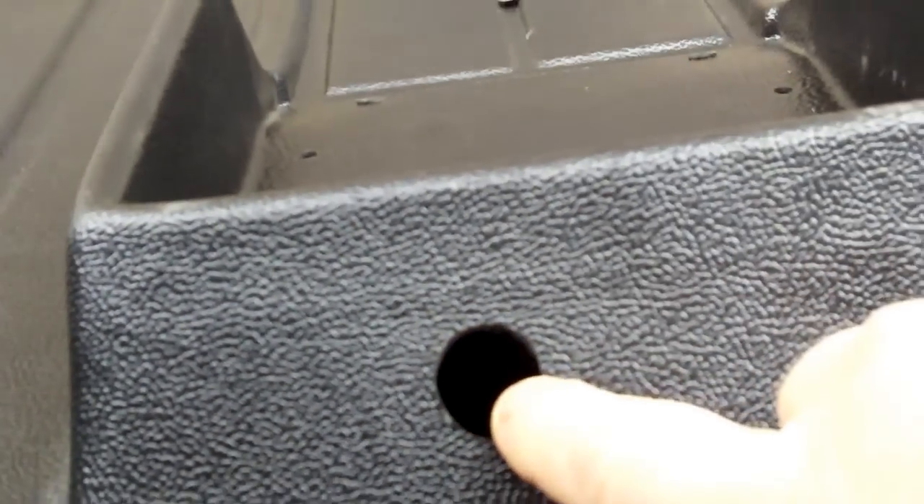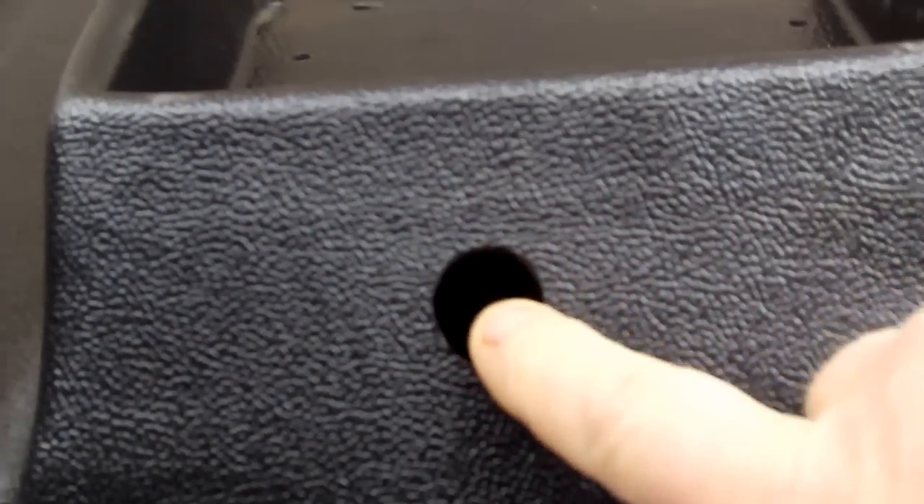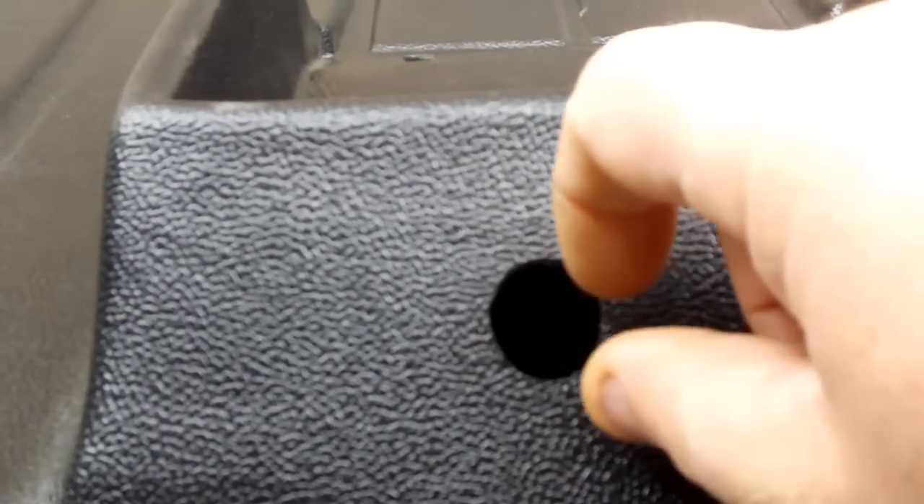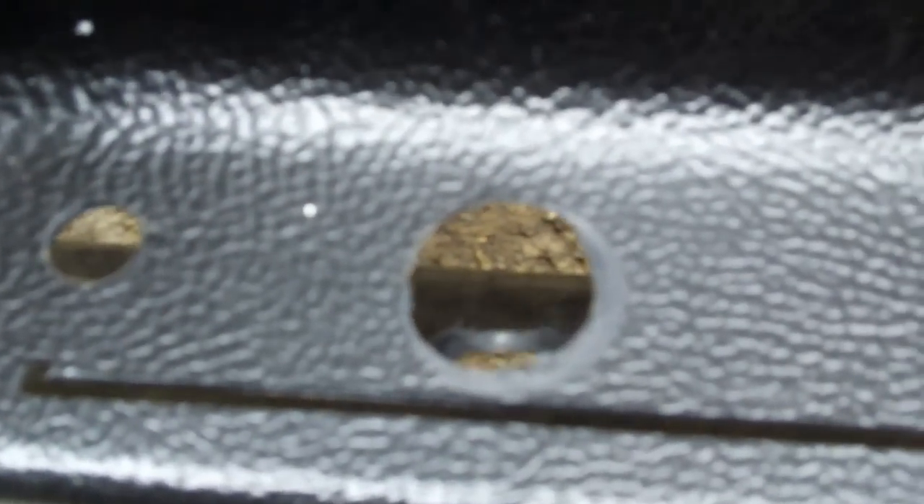As you can see, I drilled a hole in the back here. I run my wire for the CB antenna — it's a dual that comes to a single — and I also bring the CB's power out of here. I cut another hole there and that's where I run the wires for the stereo radio through. There's another hole in there that I run some other wires through. Just make sure you've got enough holes.